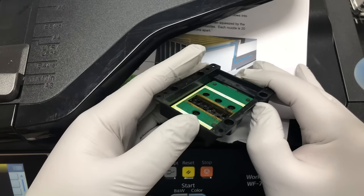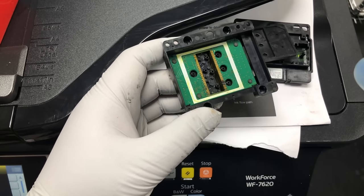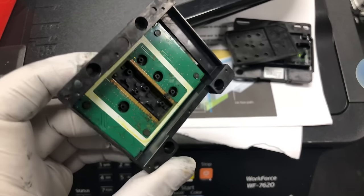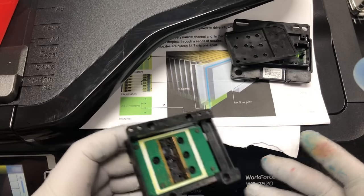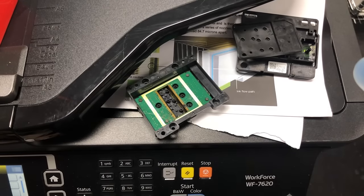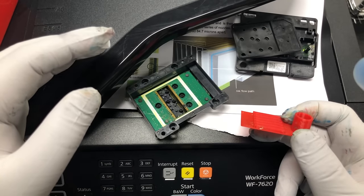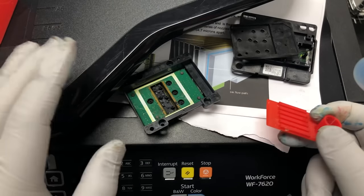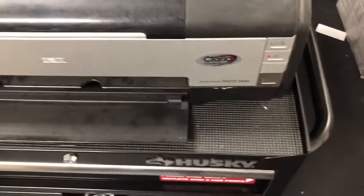from her family reunion. If we see an error 0x92A after we flush the printhead, the motherboard is toasted. The second thing is you may also damage the thin film inside the printhead that we mentioned earlier. Therefore, direct flushing is effective if the clog is minor, but it's not a good idea for a harder clog. In the following sessions, we'll discuss how we do the direct flushing a little bit differently.